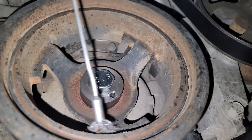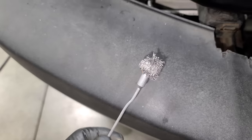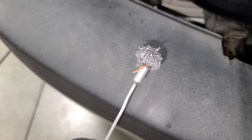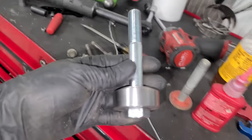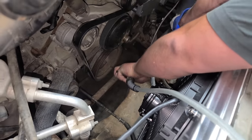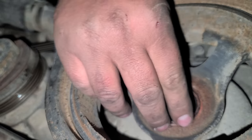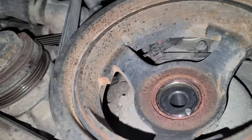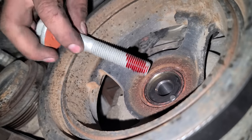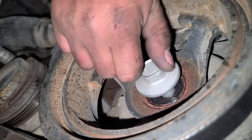All these flakes with the magnet. Look at that. This is literally my crankshaft on a magnet. I don't know what that is. Is that a twig? We picked up a twig. So then we just removed this guy. Right now we're going to install a pin into the crank. And it pushes right in. A couple of love taps. And now we put a little bit of Loctite on a brand new harmonic balancer bolt. And that'll go in.